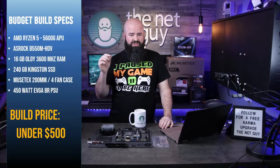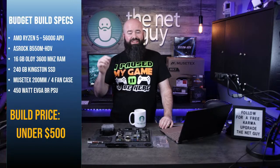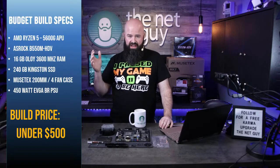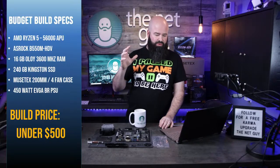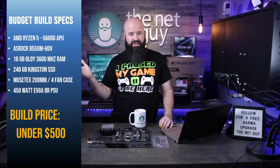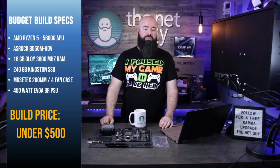There are some decisions that I made when building these specs out to get to under $500, and it's always going to be a give and take. If you want to upgrade a certain thing, you can. Like, this is the 5600G APU, which is the combo graphics and CPU in one. But if you wanted to go to the 5700G, if that's what was available at the time, more power to you. So there are some really cool combo ones right now.